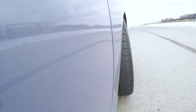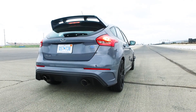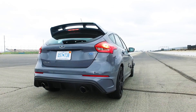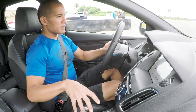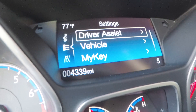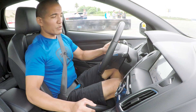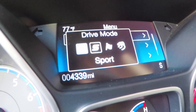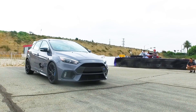This RS happens to have a launch control mode. All-wheel drive cars can be tricky to launch because you have a lot of grip, and if you have a manual transmission, all that grip when trying to get off the line quickly sends a lot of shock to the drivetrain. With systems like this, it's able to optimize the all-wheel drive — slipping clutches here and there — to get you off the line as quickly as possible. I've also switched it into Sport mode, which gives us a lower level of computer intervention and allows the wheels to slip a little more. Let's give this a shot.